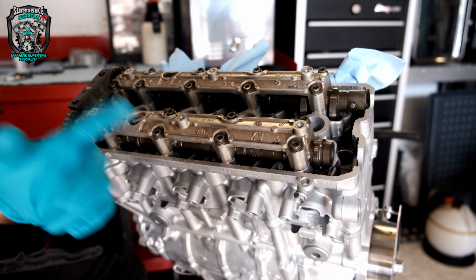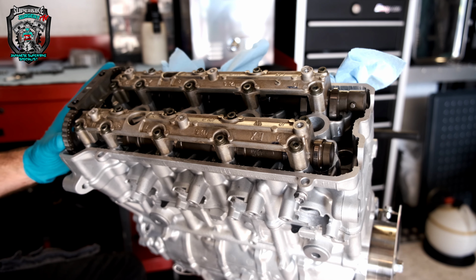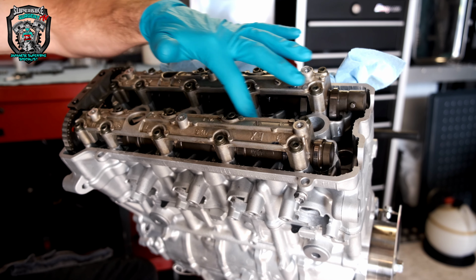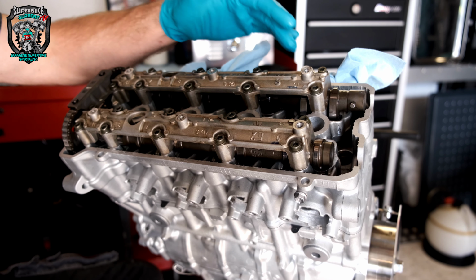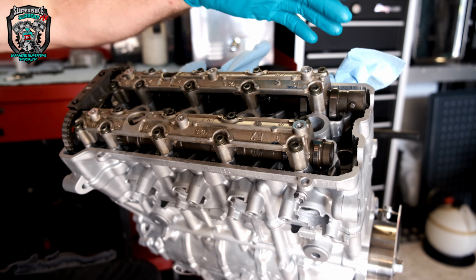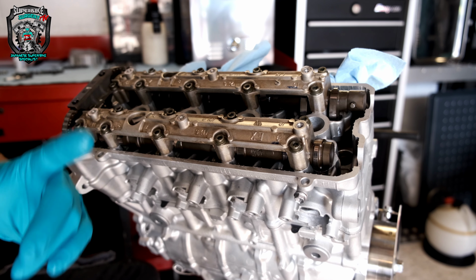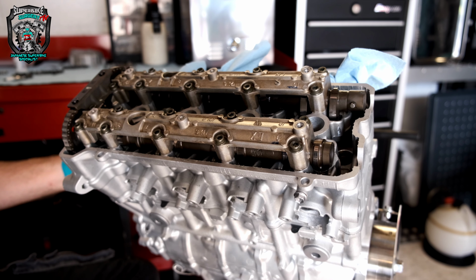What I'm going to do now, I'll spin the engine over a few cycles, and then I'll redo my TDC mark and double check my valve timing. Then I'm going to recheck all the valve clearances, and if that all checks out well, which I'm confident it will, 4 O-rings and 4 little dowels, new cam cover gasket, put the cam cover on, button that up, good to go. There's a little bit of cam lube on there. You'll see as we start it, but I'll either disable the ignition system or the fuel pump, and we'll crank it until the oil light goes out, so we know we've got oil everywhere and good oil pressure before we fire it up, but we'll get to that. So spin it over a few times, double check the valve timing, do the valve clearances, lid on, and then oh, we've got the generator cover to do.